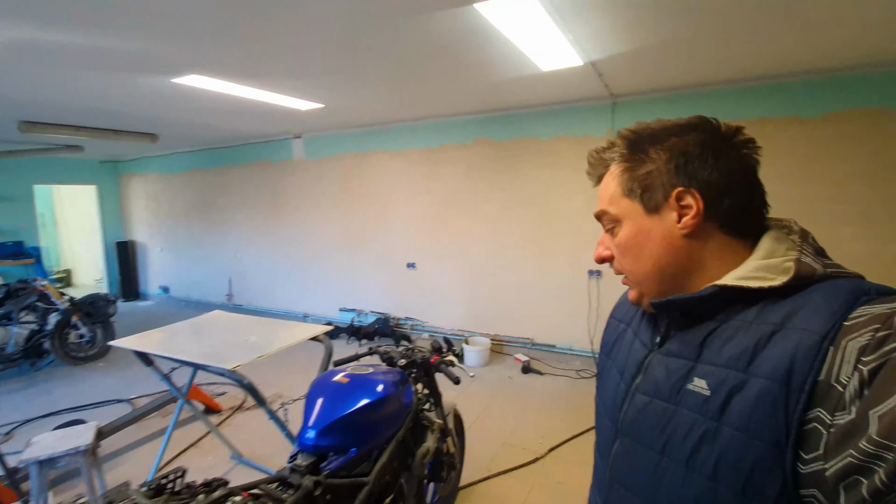So let's start the process with the assembly of this motorcycle. I don't know if it will be noticeable, but I have to fix this issue. So I will use Bondo. I don't want to unscrew the entire cap, because there is, for sure, oil, and I don't want to mess with the gasket and everything, so I use some Bondo. I will use paint with a little bit of hardener without clearing it, and the hardener will do the job, so if the gasoline leaks from the tank or something, it will still be holding.